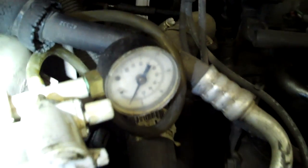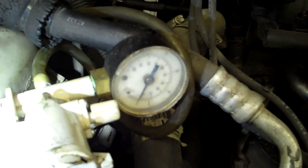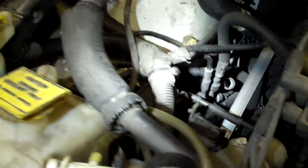I pulled the vacuum lines off of it. And this is the little green cap one I thought the other one was, but it has one clear on the other side of the engine bay. So as I look at that — look at that vacuum hose, that big ol' crack in the side of it. So I'm vacuum testing and nothing is building pressure. I just start picking out the lines and picking them off. The one coming up from this side was good, but the one coming up to the purge solenoid is bad. So we're gonna replace that line.